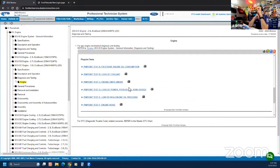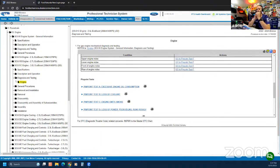We got to use the chassis ears if this rear axle still has this clunk. You got the wireless chassis ears? I believe so. You could use the oscilloscope and hook it up to a 3mm jack and connect it to the chassis ear so you can see the noise on a line. Instead of listening for it in the chassis ears, you hook the 3mm jack up to the VCMM, turn on the oscilloscope, and you can see the noise instead of just having to hear it. All with a 3mm jack adapter. Whoa.